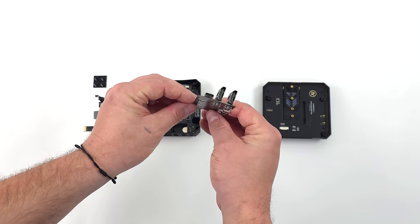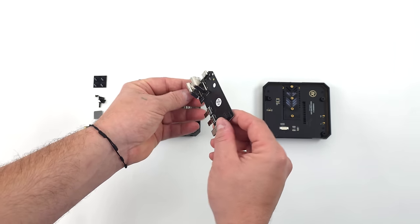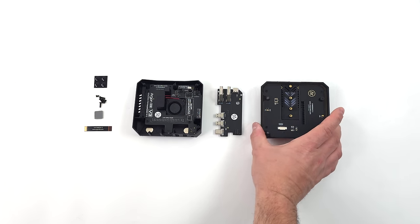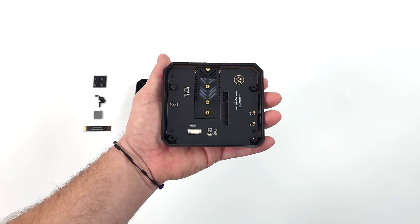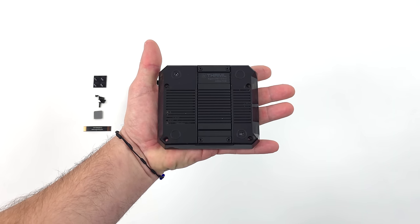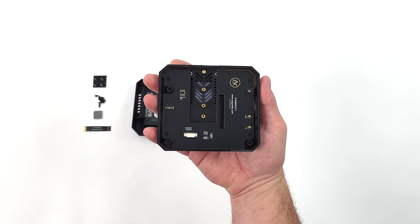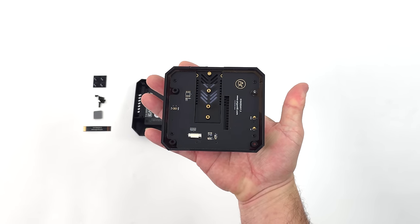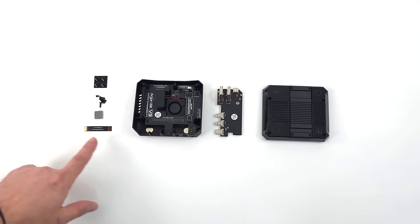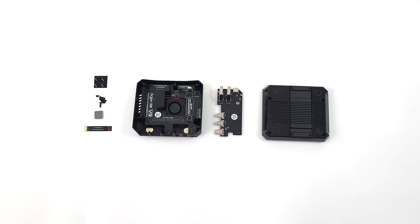Here's their HDMI and power board, which brings those micro HDMI ports on the Raspberry Pi 5 up to full size — that's one of my biggest gripes with the board itself. So with this we get two full-size HDMI outputs. We've also got the bottom half, which is going to house our NVMe drive. This is not running over USB; since the Pi 5 does have PCIe, that's how it's connecting. With older Pis we used to connect SSDs via USB, but that hurt performance. With this new PCIe setup, we should have a much faster system.